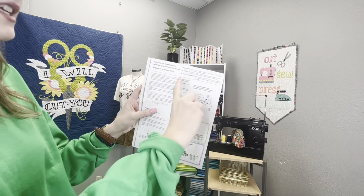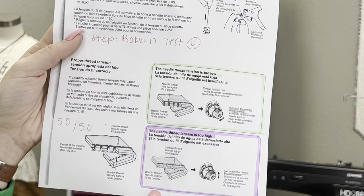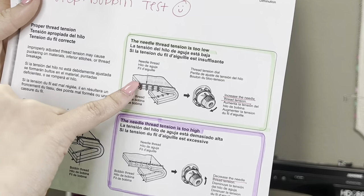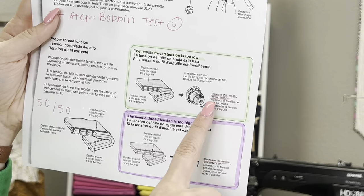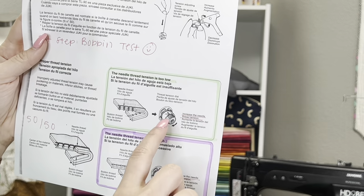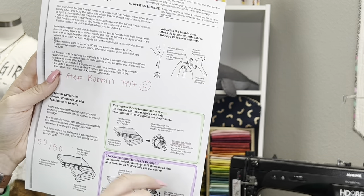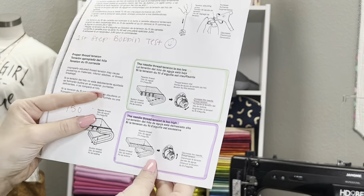I found a copy of the page from the TL manual. It talks about bobbin tension being step number one, and then proper tension — which looks like 50/50. That's in your manual; this isn't anything fancy I put together. The most common problem other than skip stitching is where your top tension looks great but the bottom looks like a straight solid line with no defined dinosaur-hump stitches. In that case you need to increase the needle tension — turn it to the right to apply more. Do it in half-turn, 30-minute increments.